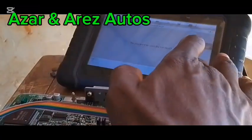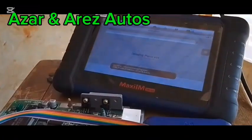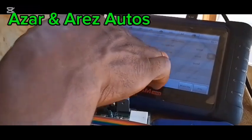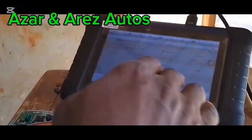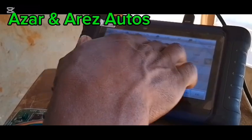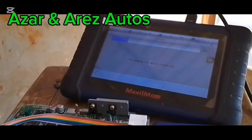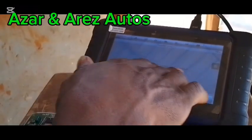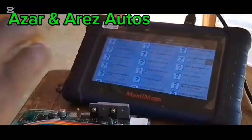Do I want to save data? Yes, I'll click save. It's going to decode it. It's telling me there are 20 keys in the system. This particular chip is here, but I'm going to rewrite it on key 1 — the big key. It's going to delete key information and create new data. I've generated a new file. Yes, I want to save it. Click save.